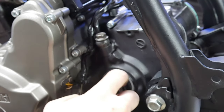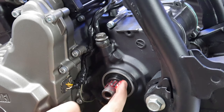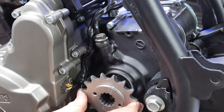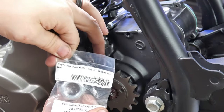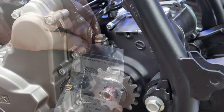I'm adding some grease here — not because it needs it as a friction barrier, but because it'll act as a rust barrier and hopefully keep everything a little bit cleaner. The drive sprocket is a Primary Drive 14-tooth sprocket, and I'll be adding the Eagle Mike prevailing torque nut instead of using the standard nut and lock washer from Kawasaki.